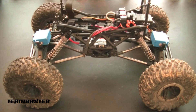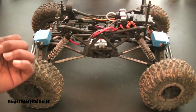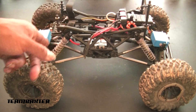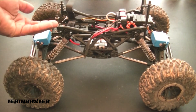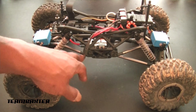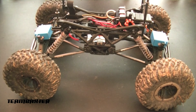In order to get the battery to fit in the front, I had to turn the transmission around — now the gear cover is facing rear and the motor is facing the front. What this does is give clearance for the full-size battery. When I flipped the transmission, the drive shafts didn't line up correctly, so I ended up flipping the axles as well. These axles have each been reversed 180 degrees, and what that does is line me up with the transmission a little better — it actually gives it almost a better driveline angle to the transmission. I also lowered the upper links, which gives me a little bit less articulation, but that's probably better to keep it out of holes and obstacles.